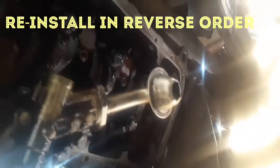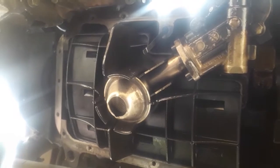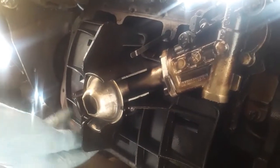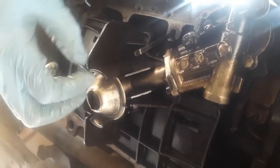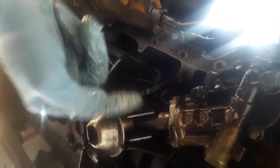I have reinstalled the black plastic cover above the pickup pipe and everything looks good so far. Now is a good time to just check that everything is okay and everything is tight. As you can see the dipstick is sitting right there. Those are the bolts that are attaching the oil pump to the block.